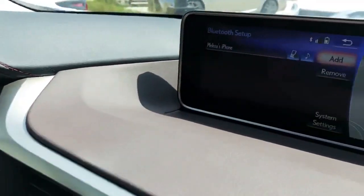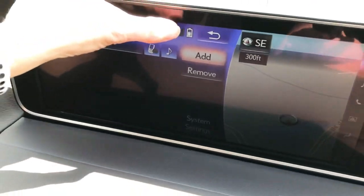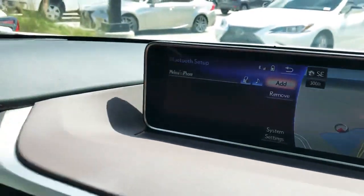Keep in mind you should now see your connection on your vehicle — we have Bluetooth, two bars of service, and a little over halfway on our battery. One of the changes with Bluetooth and iPhone is that all of your volume settings are independent of one another. It's a great idea to turn your car off and back on, then make a phone call. Once you're in that call, adjust your volume on the side of your iPhone, then adjust it on the vehicle. This applies to phone calls, Bluetooth audio, and even different apps, which now have their own volume settings. If the volume is too low, turn it all the way up on your iPhone first, then adjust it on your Lexus.